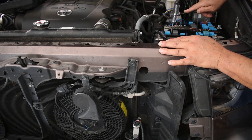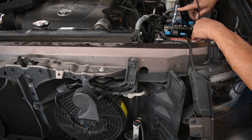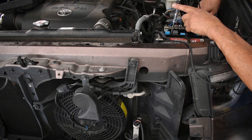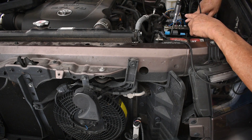The engine is on, the AC is on, I'm waiting and being patient. This light should come on — but it's not. The negative did not turn on. That is very common. Experience is a wonderful thing. Where does that negative come from? In most cases on late-model vehicles, the computer is responsible for providing the negative. I'm not condemning the computer — the computer doesn't like something in this circuit. The AC pressure sensors are at the top of the list.